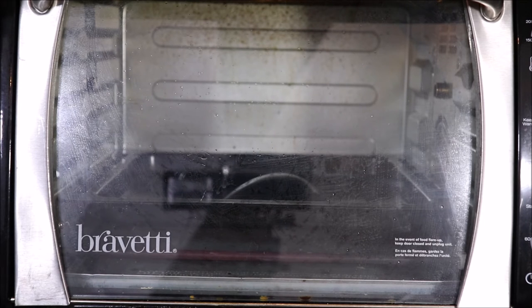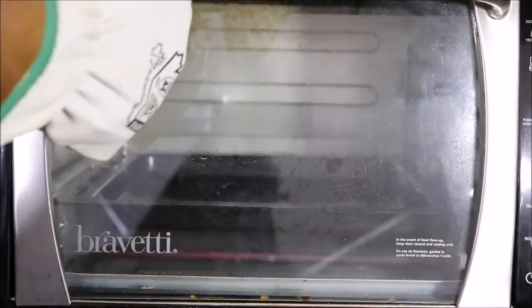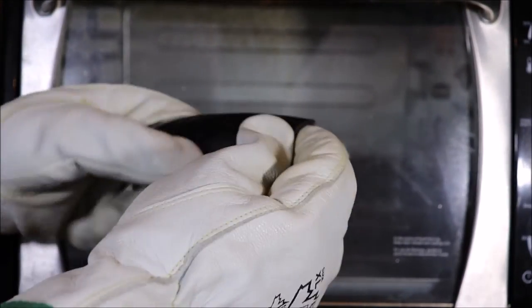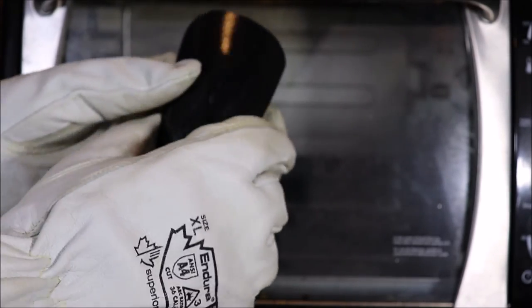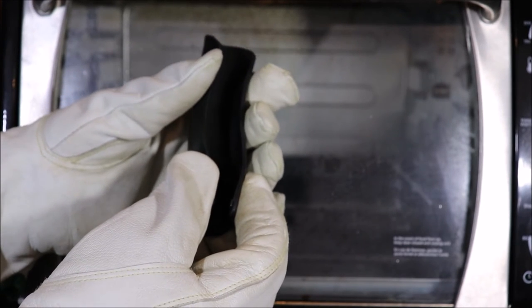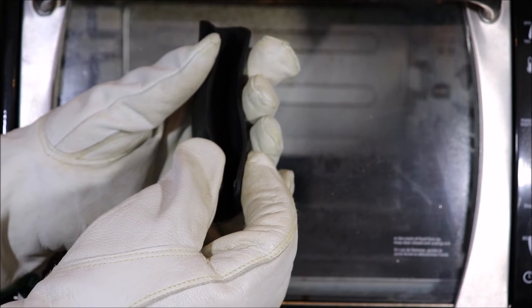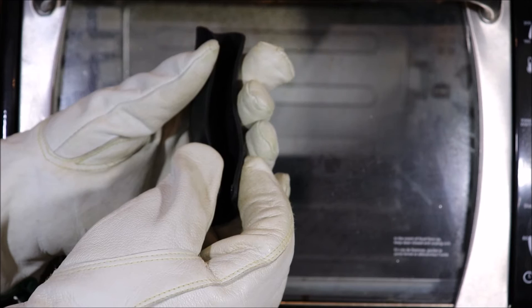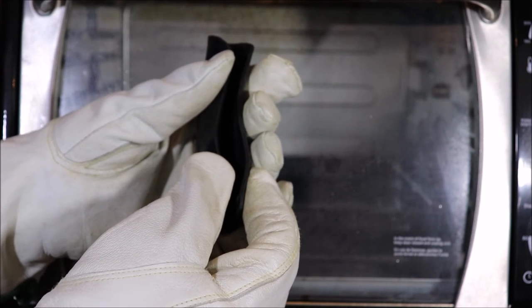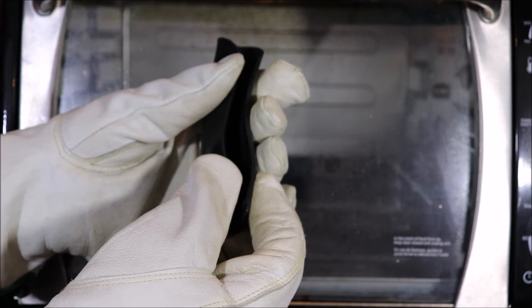It's only been about 30 seconds and I'm pulling it out to show you what's happened. Here you go — it's all rubbery, like a large thick piece of rubber. I'll form it almost like a little tube here, just hold it like that. I'll show you how it will harden up quickly and how fast you have to act when putting this on your bike. If you get it wrong the first time, just throw the Kydex back in the oven, it will soften up again, and you can try again until you get it in the exact shape you want.